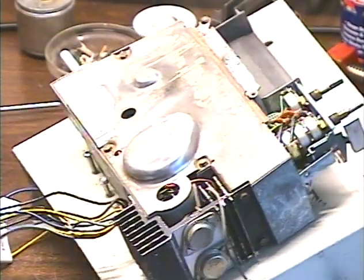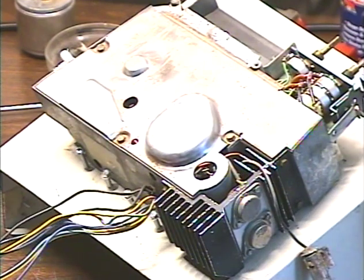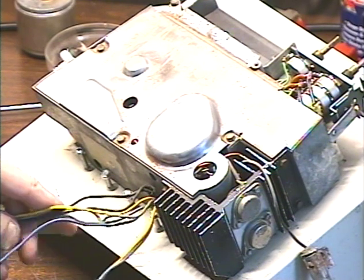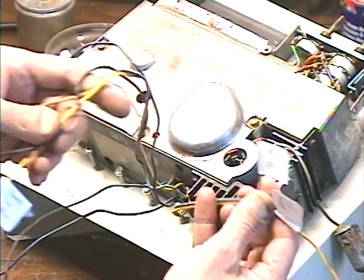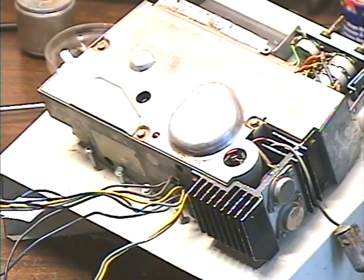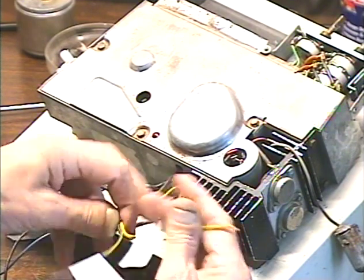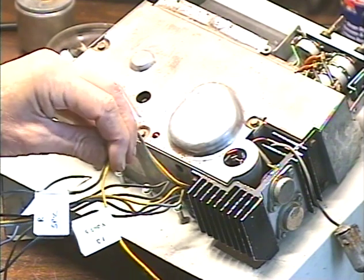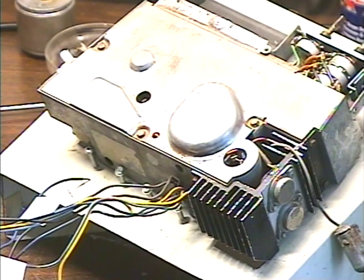You might know by now that I like to label all the wires. The envelope the customer's paperwork comes in will usually have a diagram of what the connector pins go to. This being an Oldsmobile unit and missing some of the connectors, it could be difficult to install and troubleshoot. So I like to go ahead and label all the wires so there's no confusion as to which wire goes to what. This is our 12-volt wire, this goes to our right speaker, et cetera.